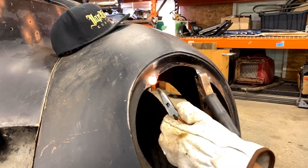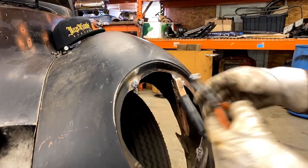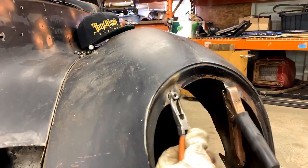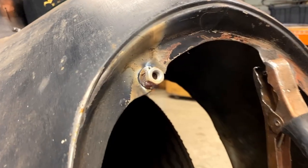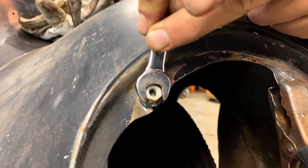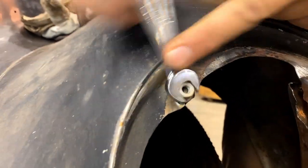We're getting that metal red hot, which is really going to help free up that stud from inside. It's a pretty dirty weld with a little bit of rust coming through. Now I'm going to tack the nut on — just tack it on two sides so we can still get a wrench on it. Just give it nice gentle wiggles, being very careful given how thin the sheet metal is on the cage of this nut. There could also be some rust on the back side of the stud trying to pull through.